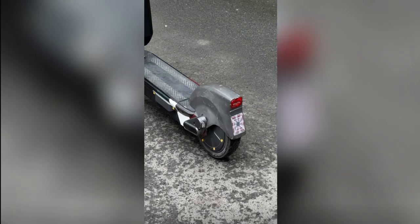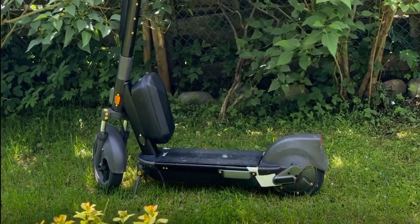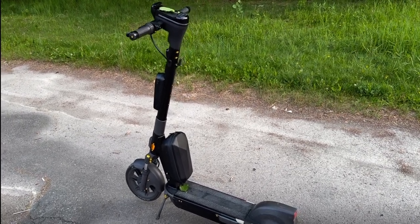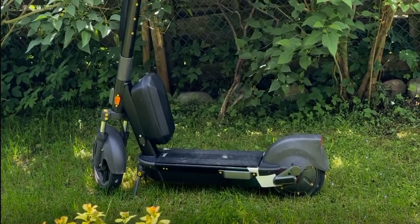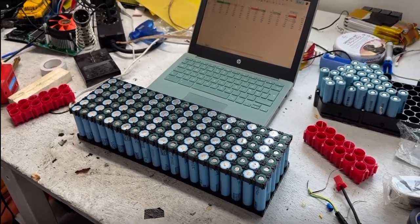We use the original 360-watt motor, and that's its rated continuous power — meaning 24/7 power without overheating. For short bursts you can go up to 6 kilowatts, but only for 5 seconds and only a couple of times per ride, because the motor has to cool down. The same story applies to the battery.